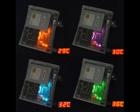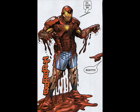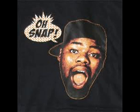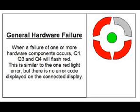To add to this, you are purposefully overheating the console, which can cause damage to many of the other components, many of which are plastic and melt faster than the metal part that you're trying to melt. Even if you somehow avoid damaging other parts of the console, heating and cooling the joints will weaken them, causing them to become prone to snapping entirely, rendering them useless.